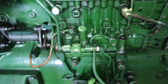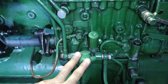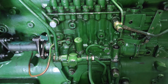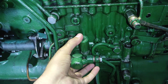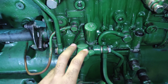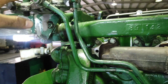Welcome to another video of Automotive Sport. Today we are going to study and see practically how this feed pump works. As in the last video, I have completely shown the circuit and the working of this fuel injection pump. Today the topic is the working of this component of the fuel injection pump, which is known as the primary or feed pump. The main purpose of this feed pump is to take the fuel from the tank and deliver it through this line up to the filters.